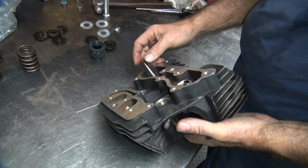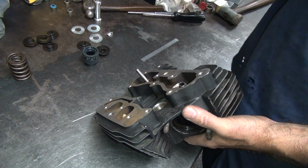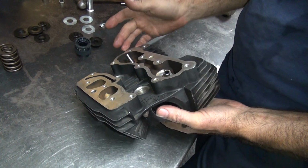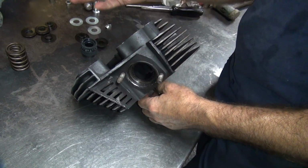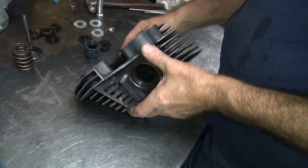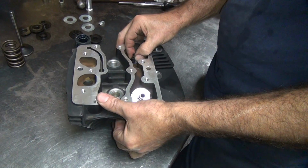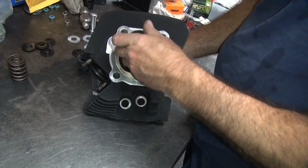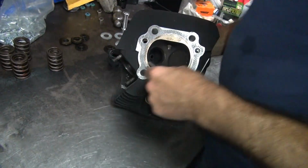Inch from the top, all right? Or you want to fill it all the way? Yeah, see if it'll fill it. So, alright, we got plenty of room on our install heights. I don't need to check every one because they're all going to be the same, because the valves are all the same heights, at least as far as we know they are. So we'll check that real quick by doing a quick measurement here.